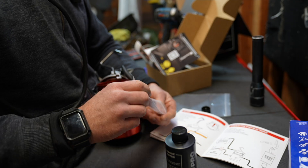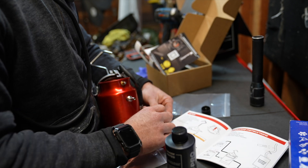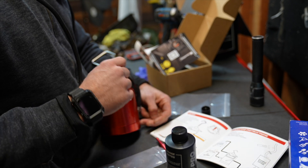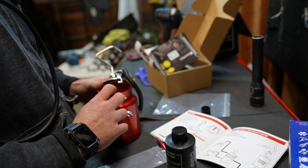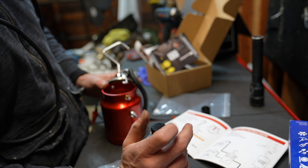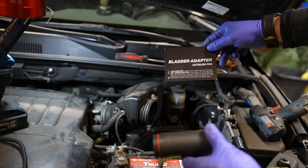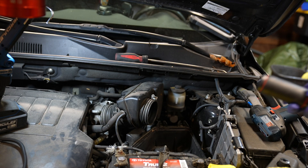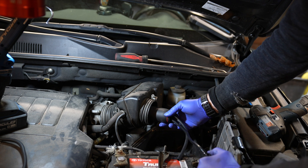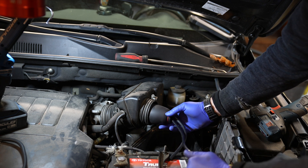There's a marble inside of the package. You throw the marble inside and whenever the oil goes below the marble you need to add more oil. Smoke machines burn baby oil, so pay attention to this next step because it is very important. We need to find an entrance and block all the exits for the smoke so we can find our leak. I'm chasing a P0171 on a Toyota and I've had some serious success with smoke machines chasing vacuum leaks.